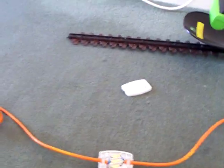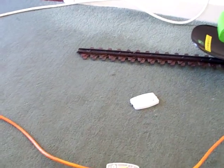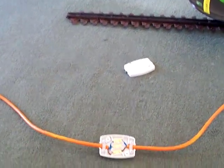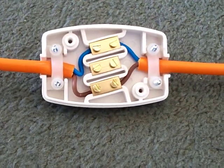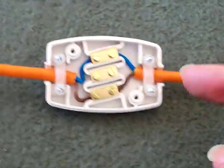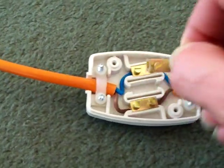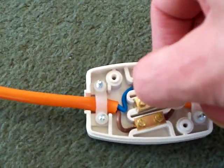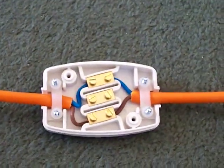Yes, it's a legendary classic — cutting the edge, swinging it round and chopping straight through the flex. I've had to repair it. There it is — the flex goes in either side, joined up in the middle. The middle terminal is obviously not used because it's an earth terminal, and this is a Class 2 double insulated appliance so it doesn't need an earth, but I'll put that back in there anyway.